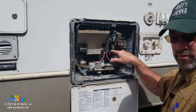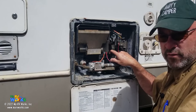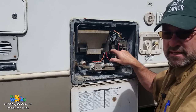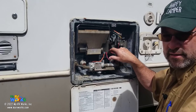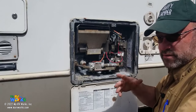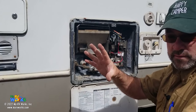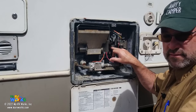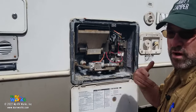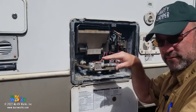The circuit is going to leave here and go through your thermostat. On these they're set to about 130-140 degrees. Basically, if the water heater is not satisfied, there should be continuity through the switch — it's a go/no-go. If I'm below 140 degrees the switch is closed; if it's satisfied, it'll be open. You can't troubleshoot the water heater if the circuit is satisfied, because the switch is open.